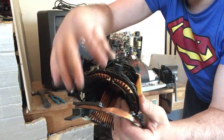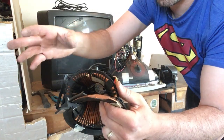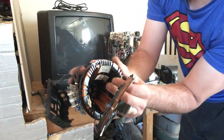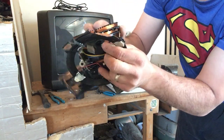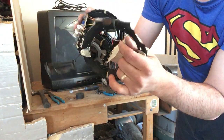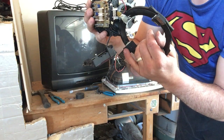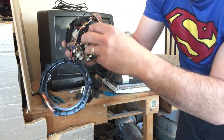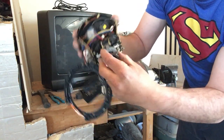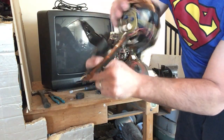The metallic casing, I'm gonna throw it into my tin shred, as well as my circuit board. This little one, I am gonna throw in my e-waste, as well as the cables. I'm gonna take these and put them into my, if it's copper, definitely my 60% appliance wire. But a little bit of plastic here, unfortunately, is gonna go to the garbage, but some great number two copper.